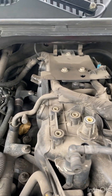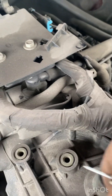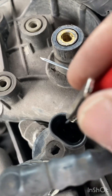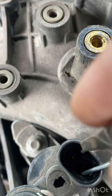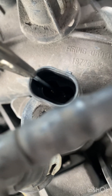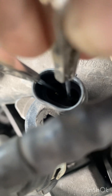I'm gonna take the red wire up to the positive side. Now what I'm gonna do is touch the prongs - doesn't matter which side - and I'm gonna listen for a clicking sound. If I hear a clicking sound, that means the purge valve is working fine, there's no issues with it. Listen - there you go, you hear the clicking noise. Do it again - there you go. You see that spark? That means my purge valve is working.